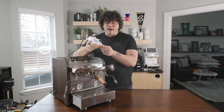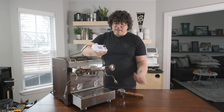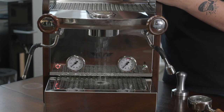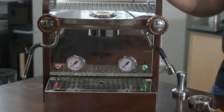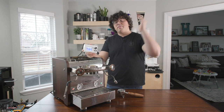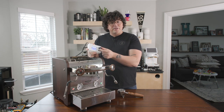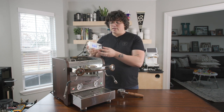On this controller, you have that rotary knob that controls pressure. Since I have this in manual mode, you're going to be able to see me start a shot here. If you listen closely, you can hear the pressure climbing and going back down — well, the flow rate going up and then back down because there's no resistance. When we have the puck in, you'll be able to see how I can control the pressure based off the position on the potentiometer on this rotary knob, heightening and lowering the pressure.